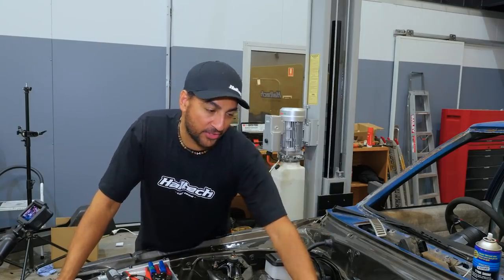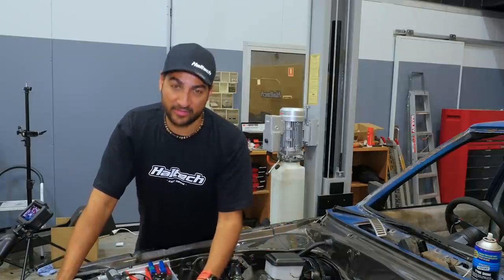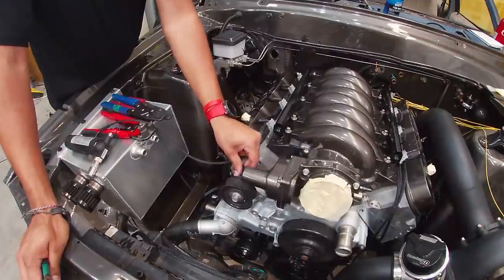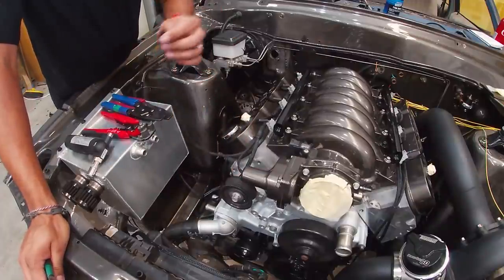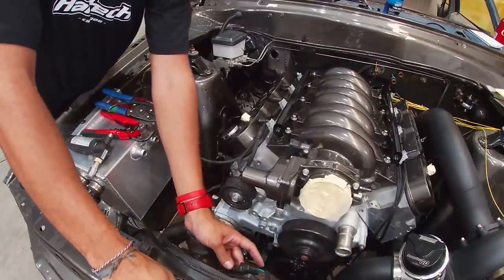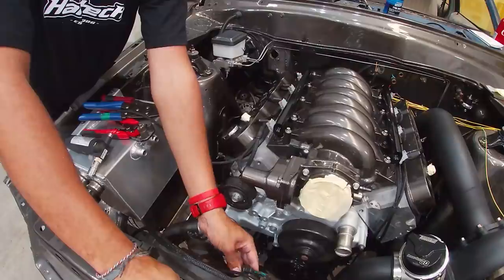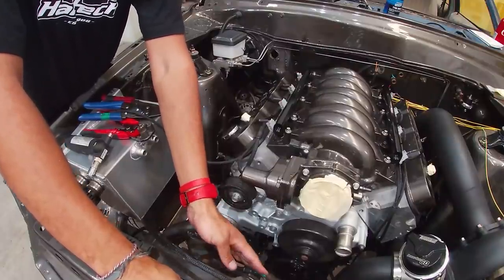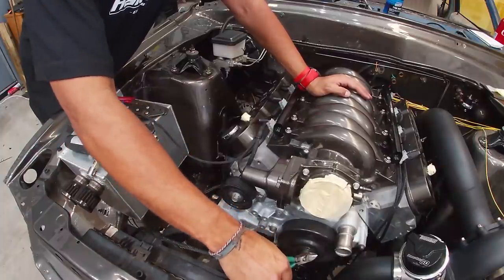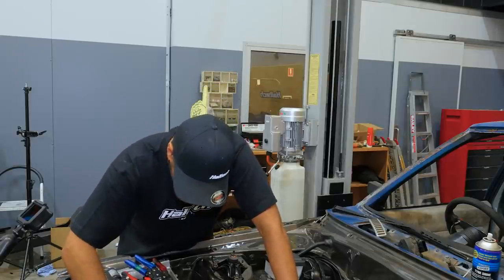I've quickly just thrown a plug and a cute little boot on the fuel pressure sensor which makes it look really nice. I'm going to work over this side for a while now and tackle the drive-by-wire plug which is going to be our e-throttle, then quickly throw a plug on our air temp sensor, our alternator plug. I've quickly done the thermofan plug - I do want to use a bigger gauge plug but due to current lockdown I can't just go out and grab one, so I'm going to replace that in the future. I've just reused the plug from the fan itself, but I do want to change that to a bigger gauge power plug because it might need to carry more current on those hot summer days - those fans will be working really hard in Australia.